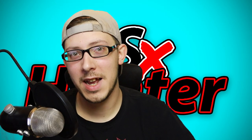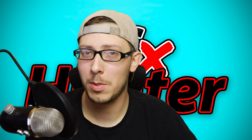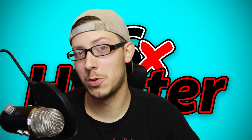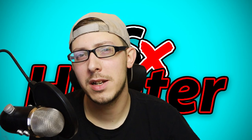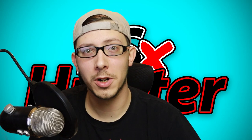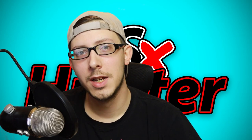As many of you guys know, I primarily work on Pontiacs and have a lot of Pontiac information at my fingertips, so we're going to take a look at Pontiac here. Though this does apply to small block Chevy, small block Ford, Mopars — you name it, it pretty much works for it. This information does, however, primarily skew more towards 60s and 70s vehicles. Cylinder heads back then just weren't what they are today — with computers really checking over everything, modern cylinder heads are significantly better. So our engine for this is just a basic 400 with 6X4 heads and an RPM dual plane performer intake manifold with a 750 carb — actually more like 800 because it's been kind of worked over.